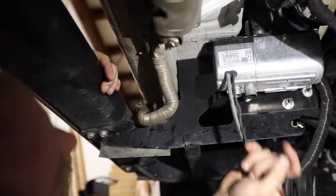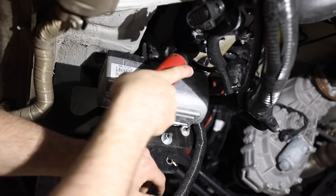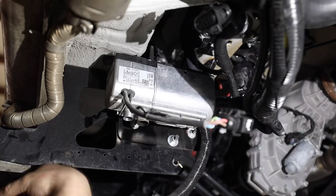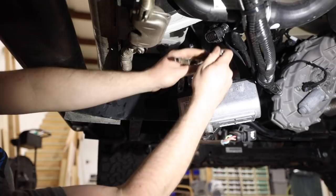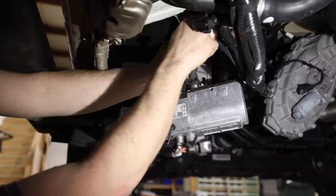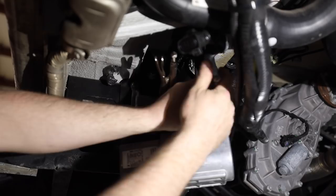Next, there's a little hex bolt right here — it's a 5mm headed Allen screw. Take a hex wrench and get it loose, then take it all the way out and set it aside. Now the heater is just sitting in the bracket and it's loose, so pop the heater down — now it's hanging by the hoses. Here's where we use the needle-nose vise grips. Go up a few inches above the top of the nipple sticking out of the heater and turn the vise grips until they do a pretty good clamp on the hose. Official pliers for clamping hoses don't work — you will take a bath in glycol.